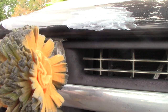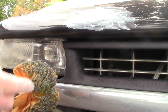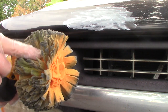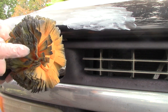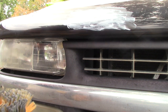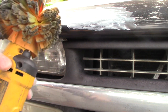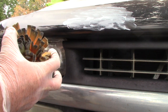Just as a heads up: if you use these buffing balls, remember it's attached to a drill spinning clockwise from behind. It has fingers on it, kind of like a rotary. Because this bug deflector has an edge on top and on the sides, you want to make sure these fingers are flying off the edge of the plastic — not coming back toward it — or it can pull and break it. I like to hold the Flitz polishing ball sideways in the direction of the bug deflector.